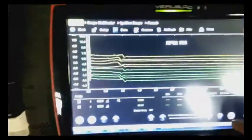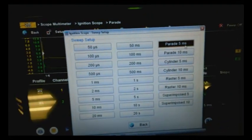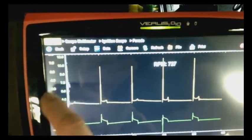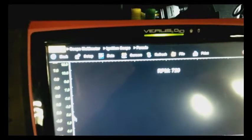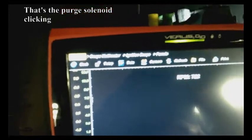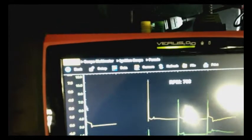Going to change the display to parade at 5 milliseconds — that looks like what I was expecting to see. You do have to play with this sensitivity adjustment here, which is where most of my problem was. Notice that if it's not set correctly you get no pattern on the screen at all, and because the scope saves the last settings, if somebody's adjusted it you can't get it back. Drop it down just a little bit to try to stabilize the pattern on the screen.